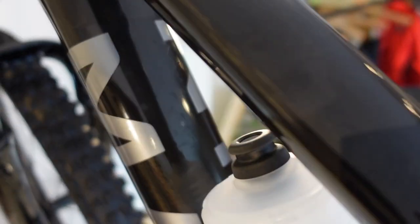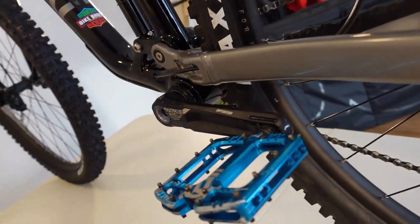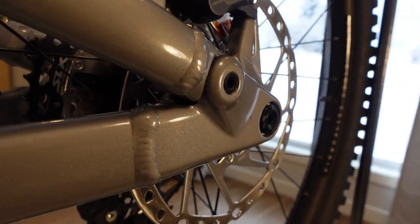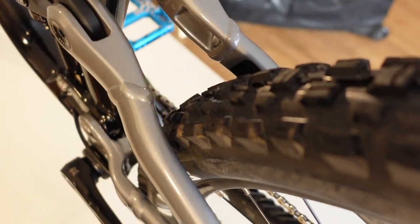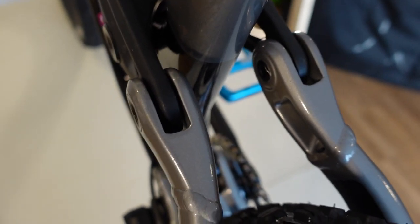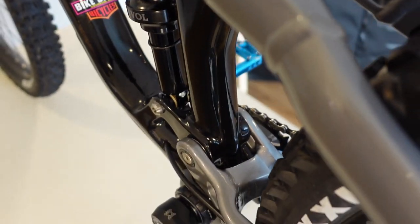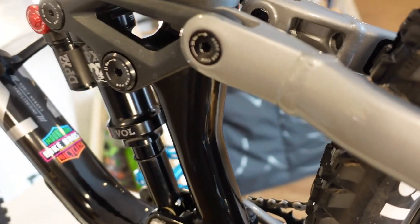I really have to say how much I love how simple the graphics are. If you look close, you'll actually see that's not just black paint — it's actually showing off a very fine carbon sheet, showing you some of these details. There's your through axle, your single pivot. Up top here, to achieve that 430mm chainstay length, they don't have anything connecting the two seat stays, which allows the suspension to really move forward without slamming into the back of the seat tube. In exchange, you can see what looks like some of the beefiest linkage hardware there is, with big thick bolts going through at those pivots — you can see where some of that extra weight might be coming from.